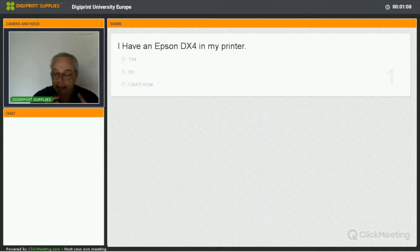In the second session, we worked on anything to do with motion — media feeding inside the printer and the carriage travelling left to right and right to left. Parts checked during that session, like scan motor, feed motor, linear encoder, belts and gears, all checked out fine, except for some settings on the scan motor and its belt that caused an error, which was resolved. Then in session three, we worked on anything to do with ink delivery.